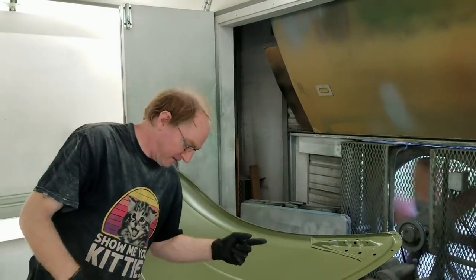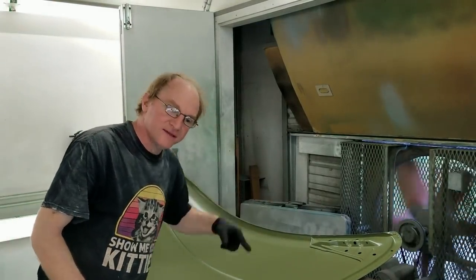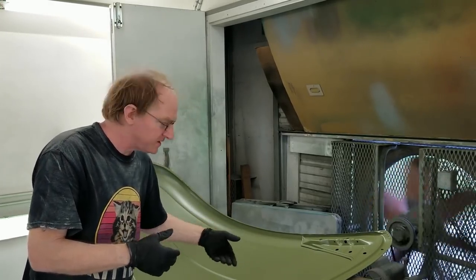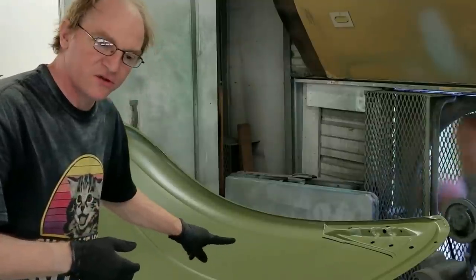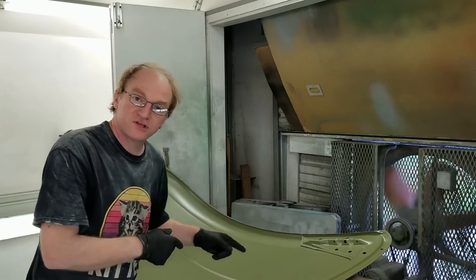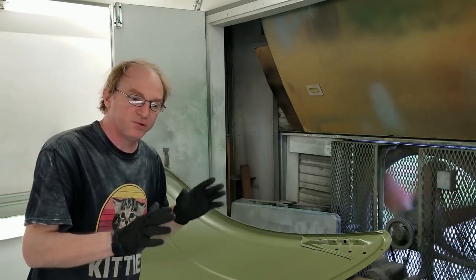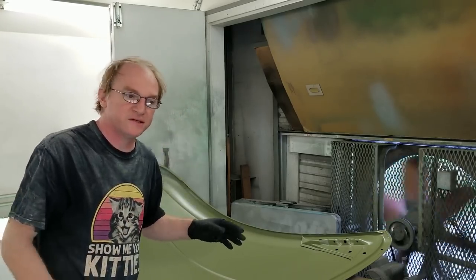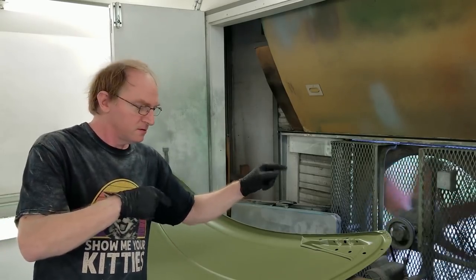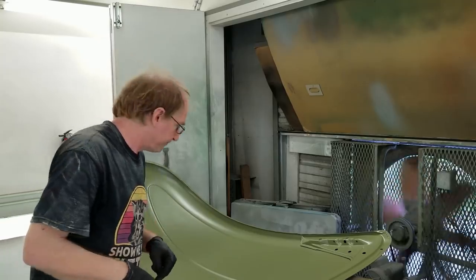All right, everyone. Lee is going to 2K this. We got the epoxy prime down. We're going to go wet on wet. We already have an hour cycle on this to gas it off. We've got two nice good coats on here. We're going to do two nice coats of 2K primer, and then we're going to start a bodywork process. What we're doing now is preliminary work on all the parts and pieces, because when Eleanor comes in after the 57 leaves, we're going to get jiggy.